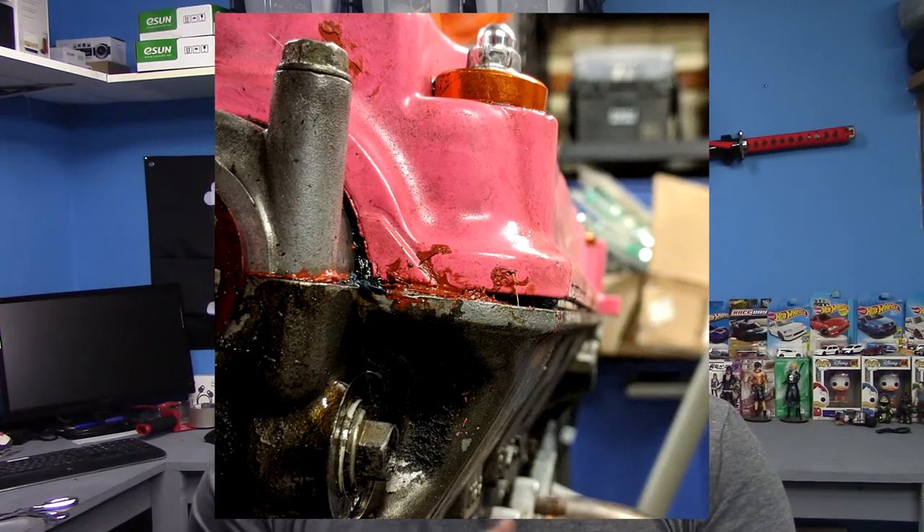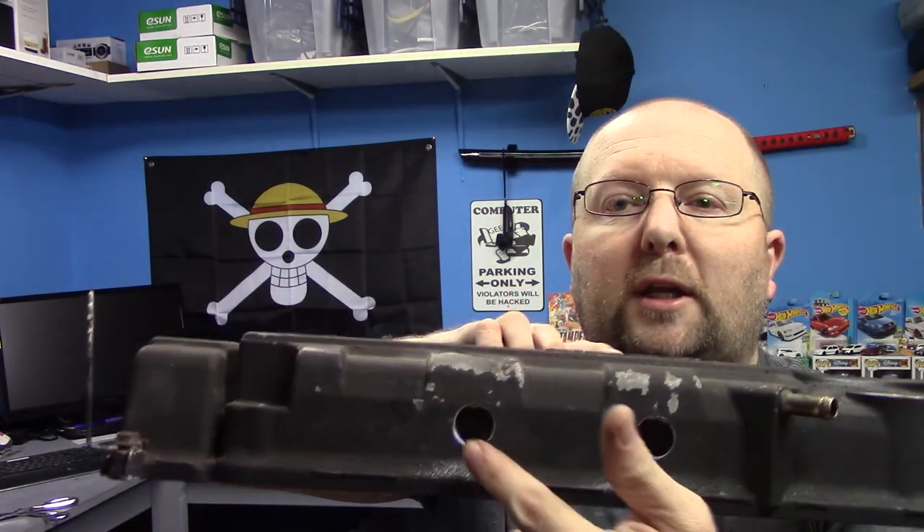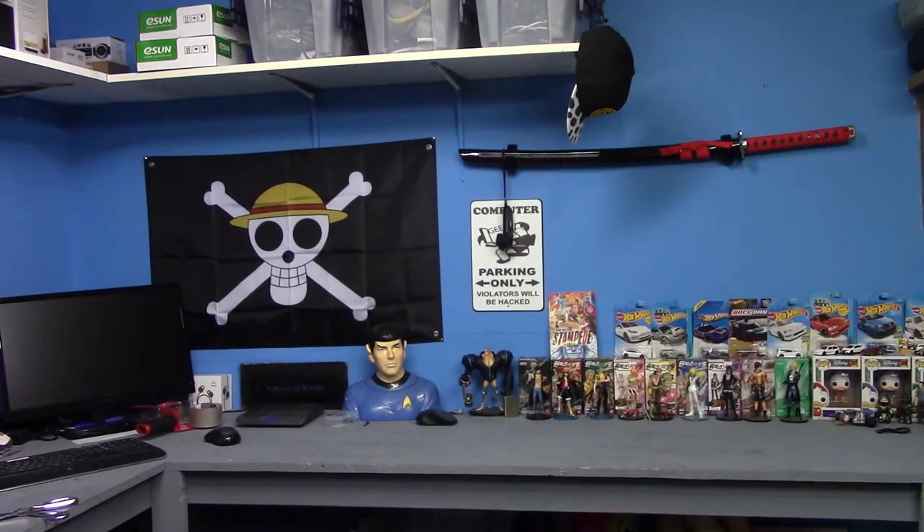I finally noticed once we pulled the car out — if you follow me on Instagram, you'll see the picture I posted of the valve cover that is bent. It looks like somebody pried up on it and it doesn't even hold tight against the cam cap. I'll post a picture of it so you guys can see that. I didn't notice until I got the motor out and looked down the valve cover and could see where the gap is actually there. I've got another valve cover with the holes drilled in it for AN10 fittings so I can get a catch can hooked up for when it's boosted, for a little more ventilation. I also have one off the rear.